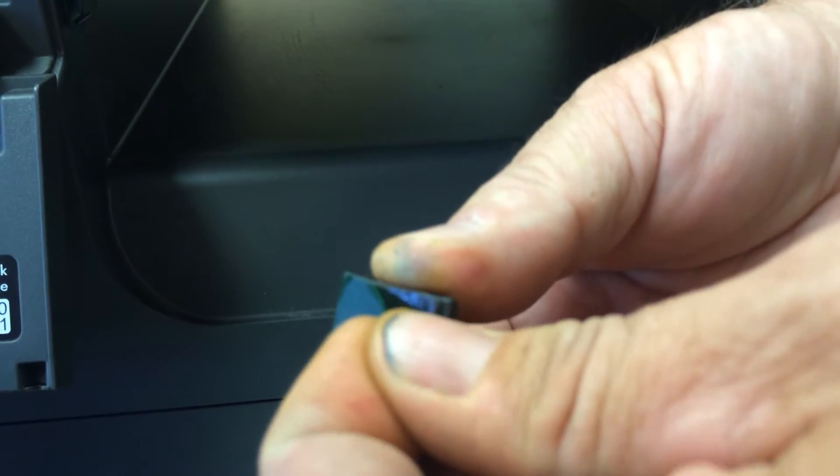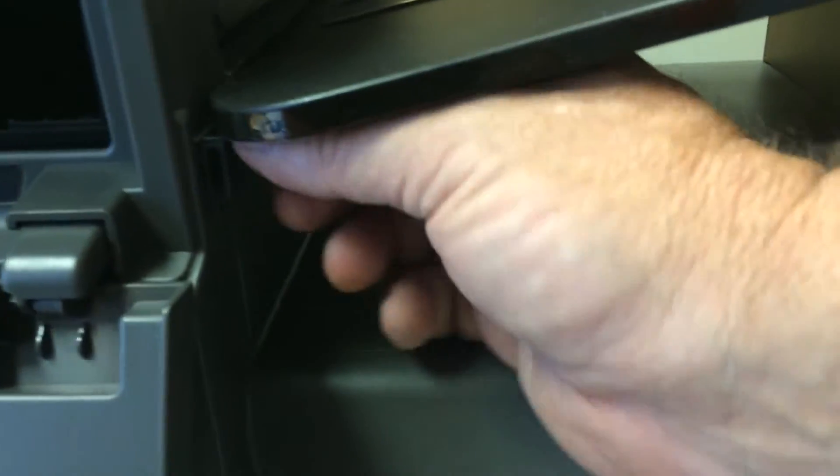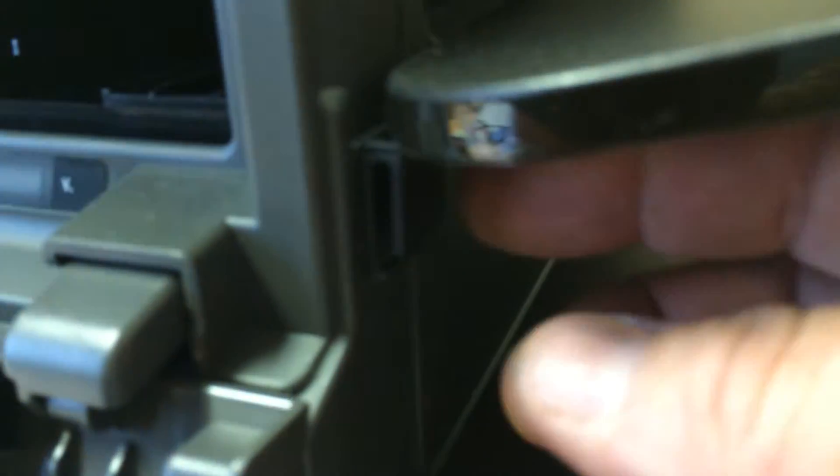The second part of the installation process is to pull off the backing film off the self-adhesive tape on the back of the clip and place the clip right underneath the front edge of the tray, about a tenth inch back from the front of the printer, and just press it to the inside wall. You can see where it's at right there, just below the output tray, about a tenth inch back from this little lip right here.